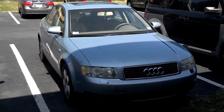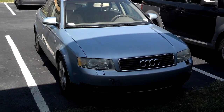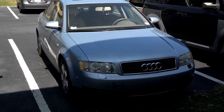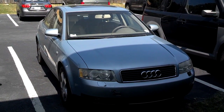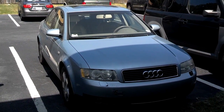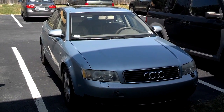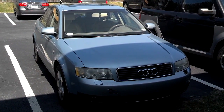I'm about to do a compression test on this 2003 Audi A4. The owner has been babying a coolant leak for a couple of months — I call that motor roulette — but I think he went from using coolant to putting water in the motor, and the other night too much of it leaked out. I believe he overheated the motor and either warped the head or cracked the block. So I'm going to do a quick compression test to see if this thing has good compression.